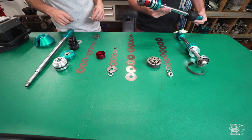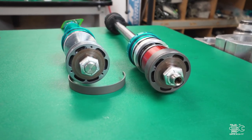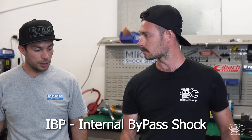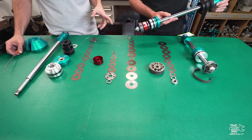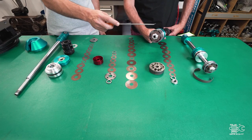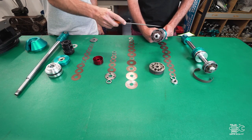This is a King Internal Bypass - a 2.5 IBP. IBP stands for Internal Bypass. There are a lot of companies with Internal Bypass technology. This one in particular has got a patent. It's very different being a mono tube design, so it still holds the same external design as a normal shock. It's just got a needle in the top, and the front of the piston has a hollow shaft.